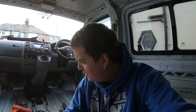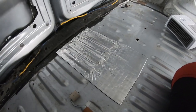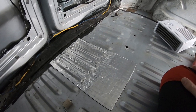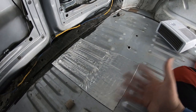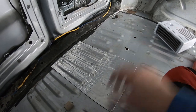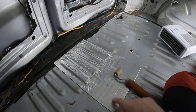I'm going to get set up and put my first sheet down in the corner to see how well it sticks before continuing. I warmed up the floor with my heat gun because the heater alone isn't enough — the floor is still very cold. I also warmed up the back of the bitumen glue on the silent coat, then put it down and rolled it everywhere. The more of it you can get touching the floor, the better it will do its job.